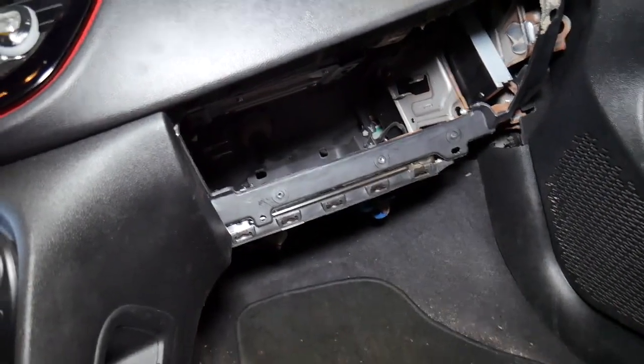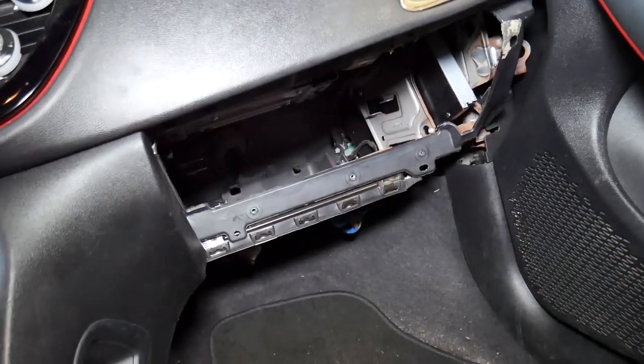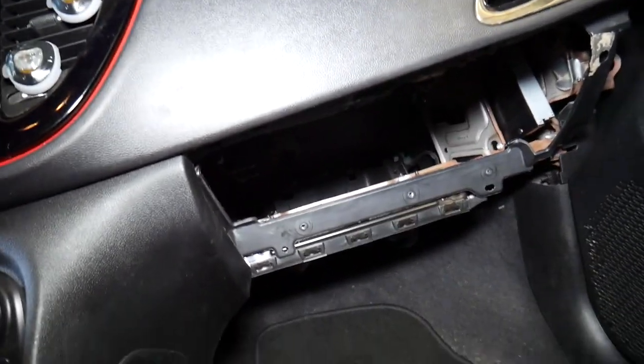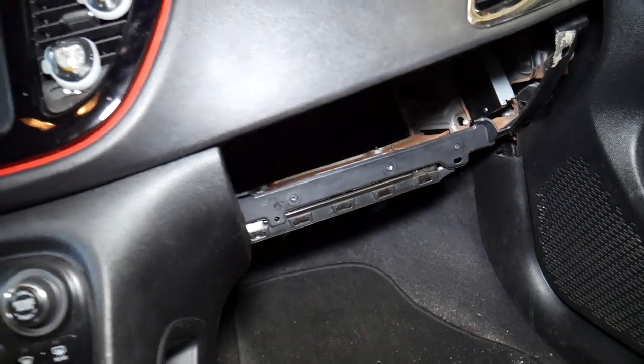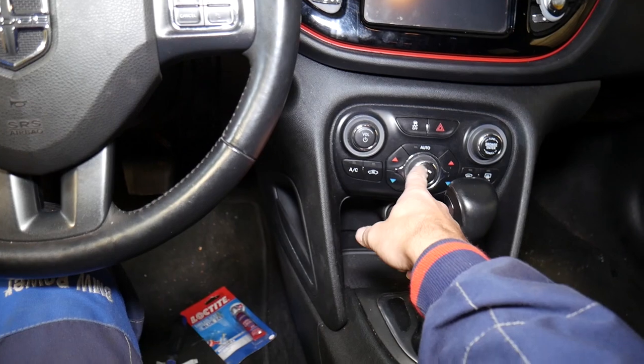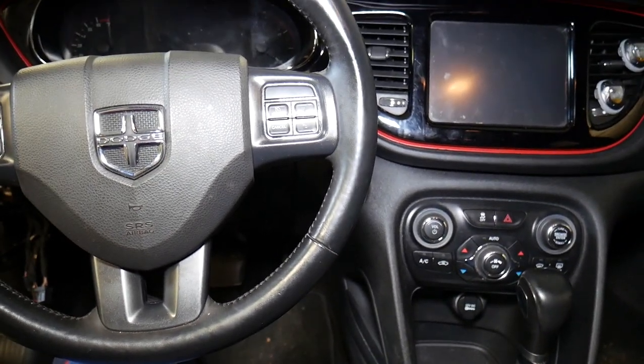You will have to remove your glove box. It's not very complicated, but you have to know where each of the screws is located, otherwise you won't be able to do it. So we'll go ahead and start on this one, then continue with the blower motor fan resistor removal and replacement. If you need to buy a new one, any replacement parts, tools, or anything like that, we'll have the link in the description of the video below. This is a 2015 Dodge Dart that we'll be working on, and it should be the same for the whole generation.